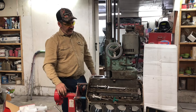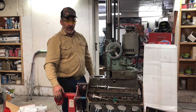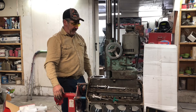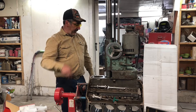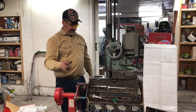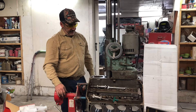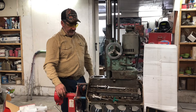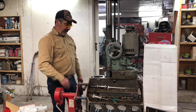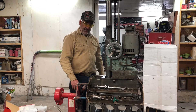If you really screw it up, you can put a sleeve in it — which we're sleeving some over here, not because they were over-cut, but because they were rotten, because they lost the seat and it didn't fall out. We're going to make this little ten thou cut. This is not going to touch everything — there'll be places it misses — and we're going to keep our fingers crossed and do a big enough cut so we're going to have it.